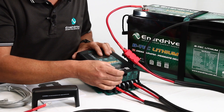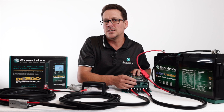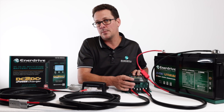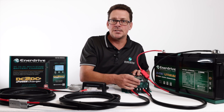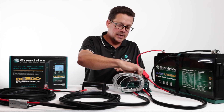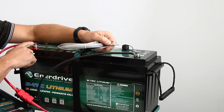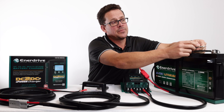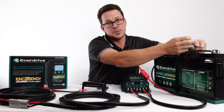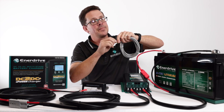There's also a remote port — not currently used, but a remote display is coming in the near future. That will allow monitoring if the unit is installed under your lounge in a hard-to-access place, or in a canopy, and you want to keep an eye on it inside your cab. The next connection is the temperature sensor port — the temperature sensor comes with the DC-to-DC and simply plugs in here, with the other end going to the negative terminal. On negative or positive connections, we always recommend a Christmas tree effect: largest cable at the bottom, stacking up to the smallest cable and smallest ring terminal on top.